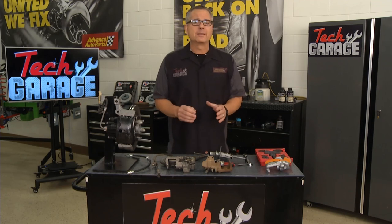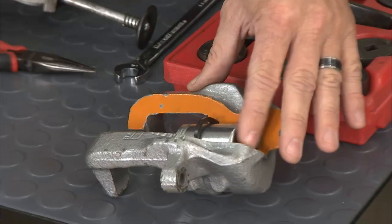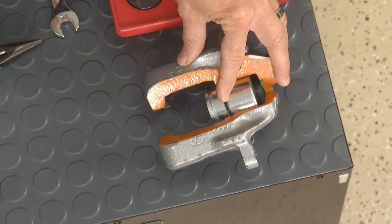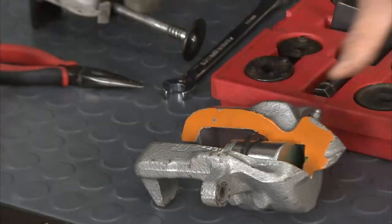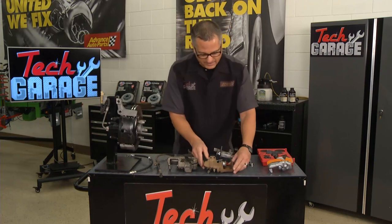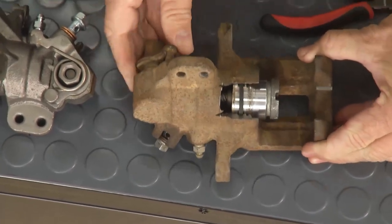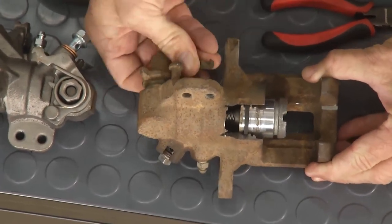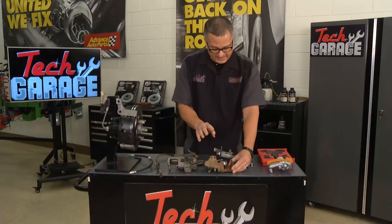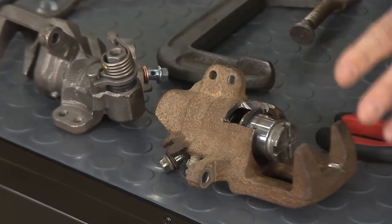What is an integral parking brake? Here's a normal caliper — fluid goes right behind this piston, pushes it over, and the square cut seal pulls it back. You're probably familiar with pushing it back with a tool or a C-clamp. But on this RSX, and a lot of cars with integral parking brakes, that's not the case. When you hit the parking brake, you're actually moving a little screw-and-nut lever inside the caliper. This one actually has a little screw, and if you try to push it back with a C-clamp without twisting it, it's going to stick every time and you'll ruin the caliper.